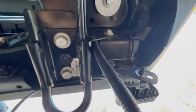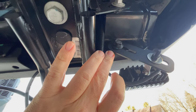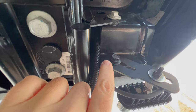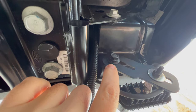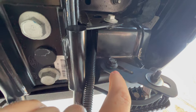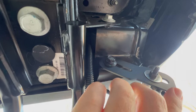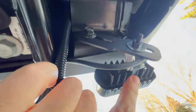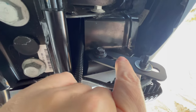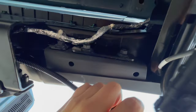Looking underneath: here's our bracket. We've got a bolt on the outer corner on the other side of our tow hooks, and we're going to take that bolt out and install our flat bracket right there. There's a slot so we have some room, but not a lot of room to move up because of the way it bends. Depending on how you install it or the size of your light, you may turn it to the outside just a little bit, then install your light through its factory bracket on the back side. Between the light and this bracket, adjust and tighten everything down to get it just right.